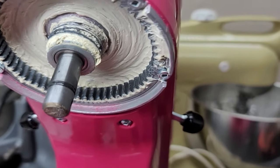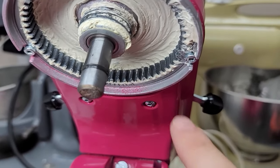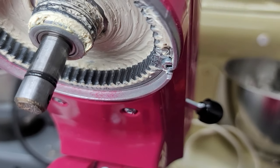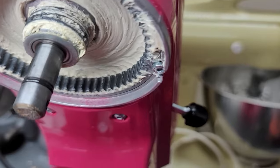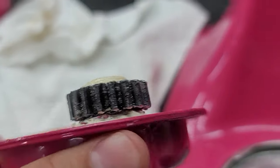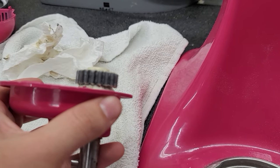Here's a good example of why we need to be replacing the grease in these machines. If you look at all the grease plastered up here, all of that was on these gears at one point but gets flicked off as they run. Look how exposed those teeth are — they still have a light layer on them, but as the machine ages that will dry out, leaving just metal on metal. Here's the gear that actually runs in that track as well — you can tell all of the grease has just been run off of it and it's now exposed.